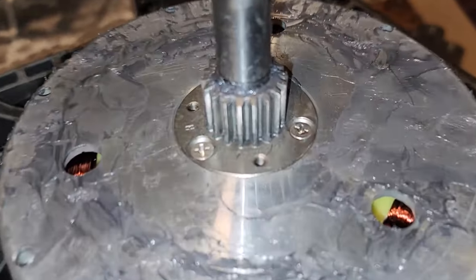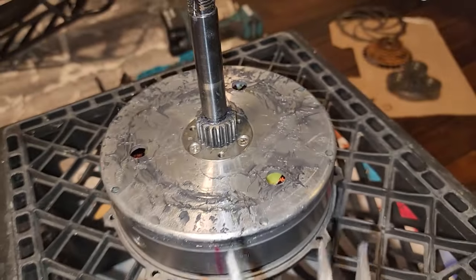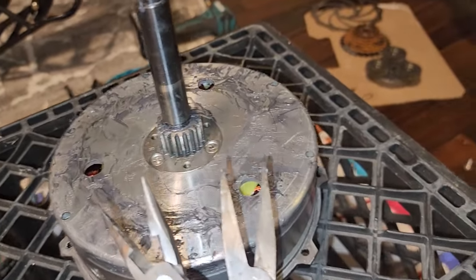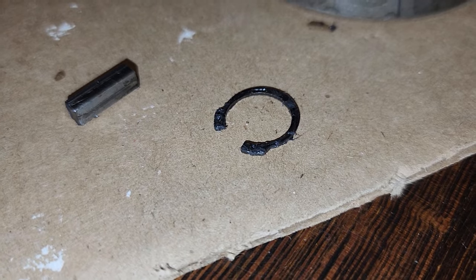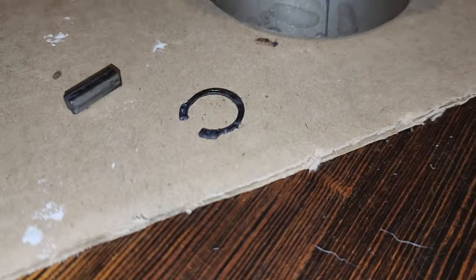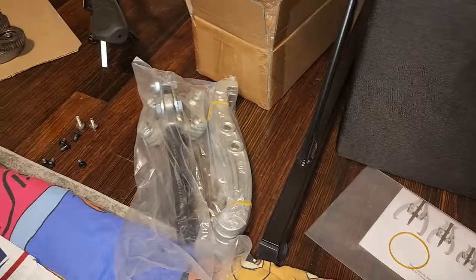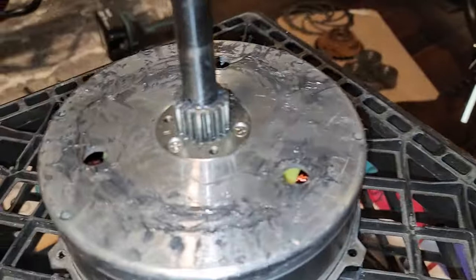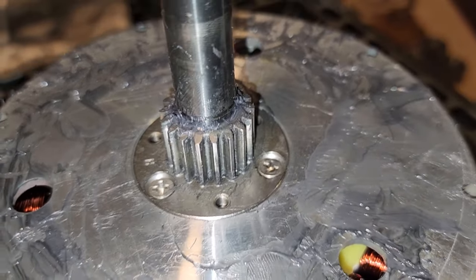All right, so I took the C-clip off, and that was a real pain. I didn't get that on camera. What I did was I just took two pliers, grabbed the little wider sides of that C-clip, and I just kind of spread them apart and shimmied it off the axle. It's much better if you have a C-clip tool. What you could always do is just buy them on Amazon or Home Depot and return them later if you're not going to use them regularly. But if you have C-clip tools kicking around, that's going to come in very handy for this.